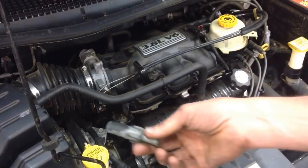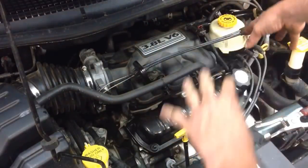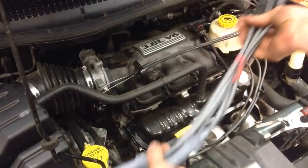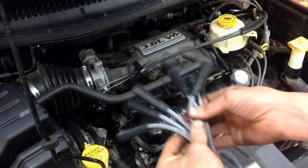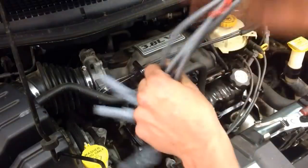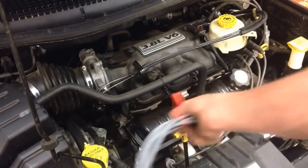When you're going back in, I usually use an old plug boot to seat the plug. Once I've got all the plugs in, then I'll start worrying about where the wires go. I haven't taken them off the coil pack yet, so I can pull them off one by one and go through the whole bundle of new replacements to find the one that matches that length. If they're OEM plug wires from your local dealership, they can actually be numbered — two, four, six, one, five, three. If they are, the job's a whole lot easier: take the old ones off, and the new numbered ones just plug into the corresponding number on the coil down to the particular cylinder.